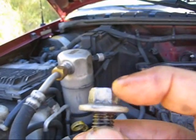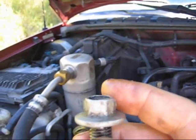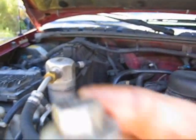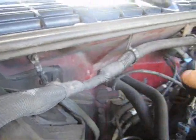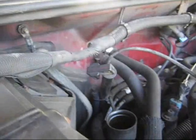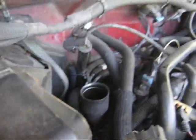Luckily for me it was just the outside part of the bolt that was done. So once this plug is in, I'll be filling the oil back here — that's why I use that long funnel, it reaches in there. Every car where you fill the oil will be a different location. It's normally marked 'engine oil' and they usually tell you what weight oil to use. In this case, 5W-30.